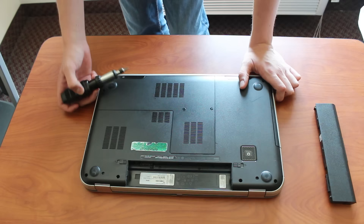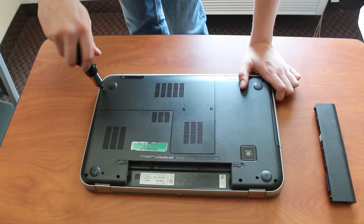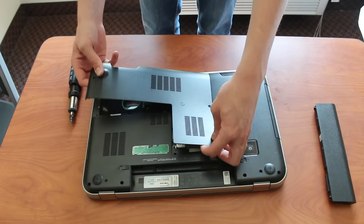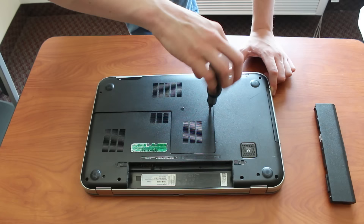I know from experience that this laptop only has two screws — one here and then one over here, and this one is a bit recessed. So I'm going to take that screw out as well. And then I can take this bottom plate off. You see how it comes off really easily, except that corner is sticking — that's because I didn't get that screw out all the way. Don't just yank on it if it feels like it's not coming out easily. I'll twist that screw a bit more, and you can see now it comes out super easily.